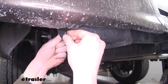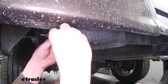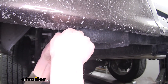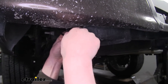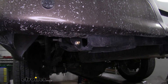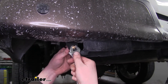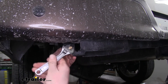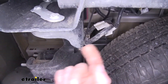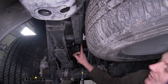Place the rubber washer on it, followed by a flat washer and another nut. You'll do this again if you're going to have independent left and right inflation valves. You don't want to tighten these too tight — just snug it down with a wrench a little bit, because you don't want to over-tighten as it is a brass fitting and the threads are fairly soft and are easily stripped. If you're installing it like we did, we ran ours down the hitch and then up on top of the driver's side frame rail, following that all the way forward to our airbag, zip tying it to the factory wiring along the way.